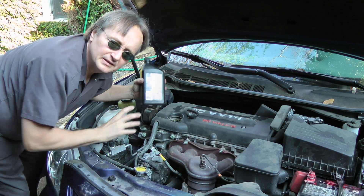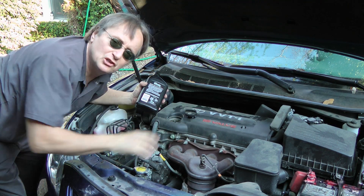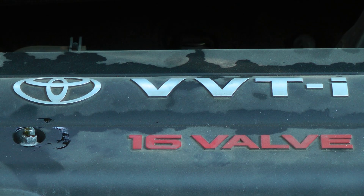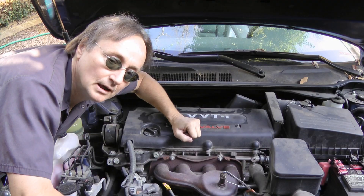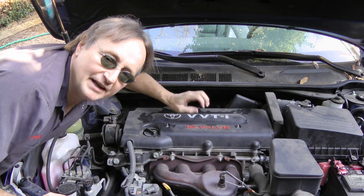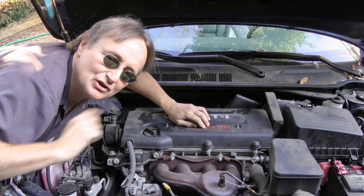The next dumb thing I see all the time is people not changing their oil frequently enough. When I was a young mechanic eons ago, I saw lots of engines blow up because people didn't change the oil enough, and it's even more important in modern vehicles because most of them have variable valve timing, like this Toyota. Most modern cars have variable valve timing engines with even more small holes that oil has to go through, and if you clog them up, you can spend thousands fixing that. So if you're using conventional motor oil, change the oil and filter every three or four thousand miles. I change mine every three or four — never have engine problems.